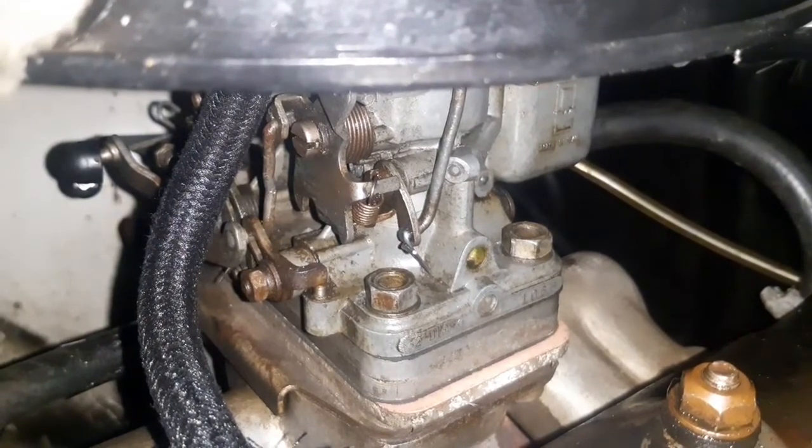So this little dog leg just hidden here - that should have a little kink in the middle of it. And basically when I was speaking to my mate Paul, trying to understand how to adjust the fast idle on this car - when you are operating the choke, you'll try to restrict the air and give it more fuel at the same time. But obviously if you've got more restriction in one place and less on another, it isn't going to be the right ratio and therefore the car's not going to want to start. So what I'm about to do is - this did have a lovely kink in the middle of it just where my finger is. What I've literally just done is sat here, bent it all as straight as it can with a pair of pliers. And it seems to work quite nicely now. So if I pull the choke out, I'll try and start it.